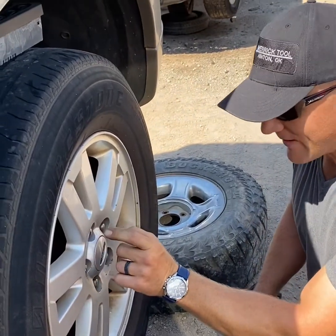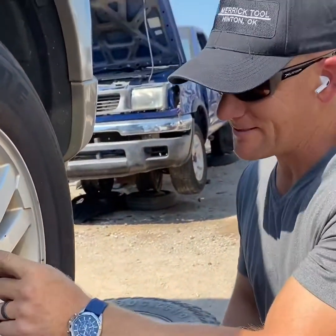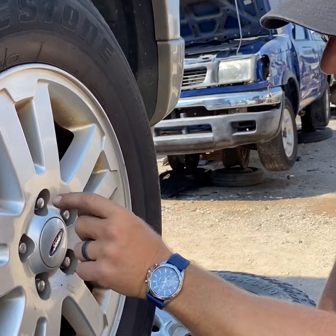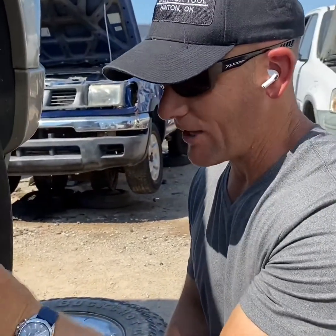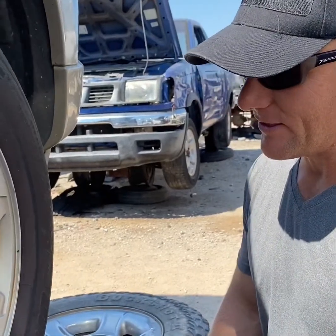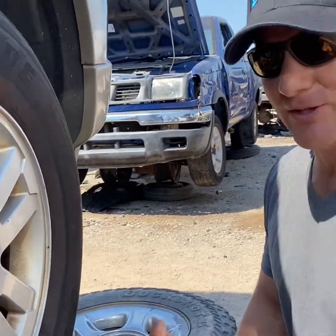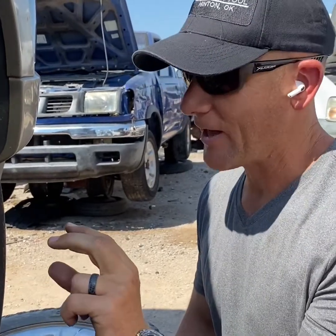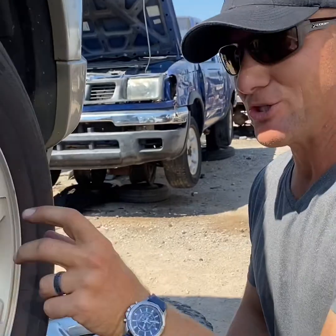If you know anything about that, you know that it is clad with a softer chrome covering over the steel portion of the lug nut. It goes over and it's crimped on. Talk to any mechanic and they'll tell you about the chronic problem they have with these lug nuts, because it's soft and it notoriously rounds off and distorts. Often it's accused of swelling. That may be the case, or it could just be a distortion.